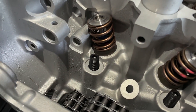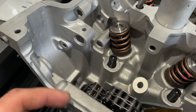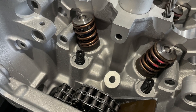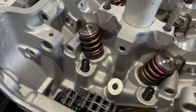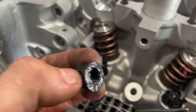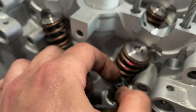Installing the washers now — there's a groove cut in the heads where the washer lays. I like to add ARP torque lube inside that groove because I don't want metal-on-metal friction affecting my torque reading. I'll add assembly lube on top of the washer as well so when the nut installs on top, the bottom of it also has something to spin on. I lube not just the threads but also the bottom face of the nut itself.